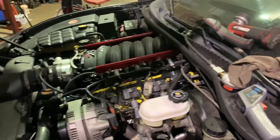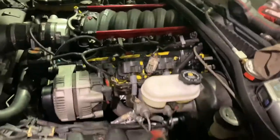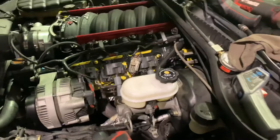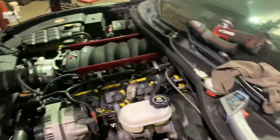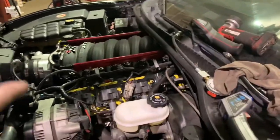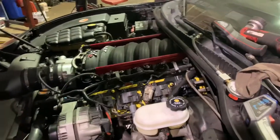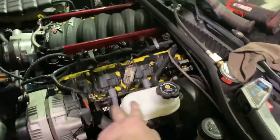So then we started wondering: is it not getting fuel? It's not getting spark? It had great compression. I'm looking at the spark plug I took out of there — I don't have a video of it, but it was a brand new spark plug, just like what I put in. It had never seen fuel before. So even before when I got it started for the first time and running, it was only running on at most seven cylinders, probably more like six. These two were still dead.